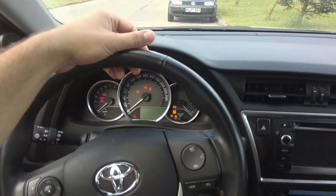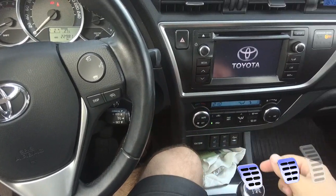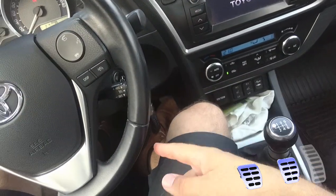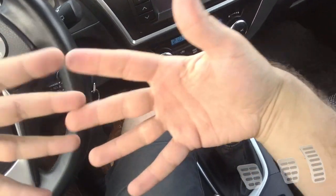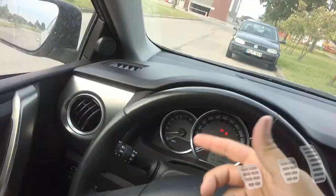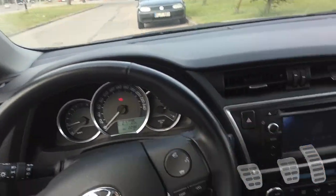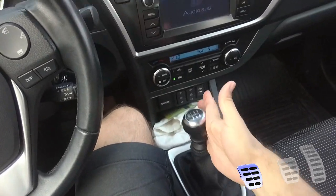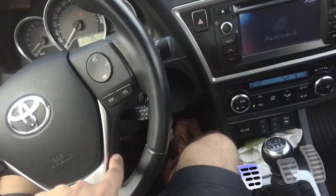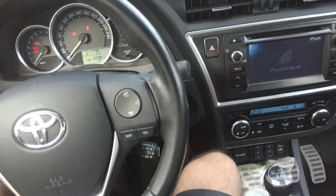I will just show you. I press the clutch pedal down and start the engine — it just turned on. Now the gear is idle, so there's nothing active. I can take my foot from the clutch pedal because neutral means there is no gear — no connection between the engine and the wheels. I can press the brake and the gas pedal. When we hit the gas pedal, we can see the engine turning, from 1000 to 8000 rpm. The more you give, the louder the motor is and the faster it turns. Now if I press the clutch, put it in first gear, release the handbrake, and just let go of the clutch pedal — let the pedal jump — did you see that? That was coupled too quickly, and bang, the engine stops. That actually happens to every beginner: they stall the car.